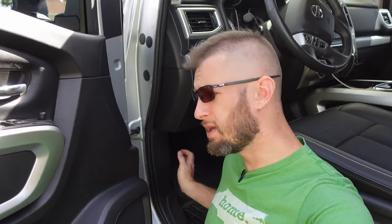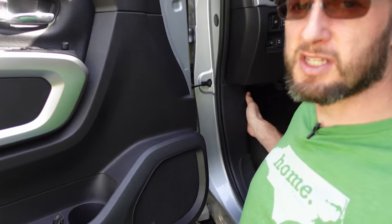This is really a pretty easy job, and for the most part all of it can be done from the driver's seat under the driver's floorboard. There are some bigger adjustments back in the rear brakes next to the actual emergency brake shoes, but unless you're really out of adjustment, you don't have to worry about those. Most of what you're going to have is just some cable stretching issues that cause this pedal to maybe not hold the vehicle like you want. So let's go ahead and see how to fix that.